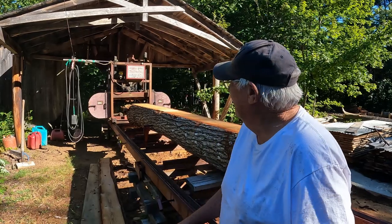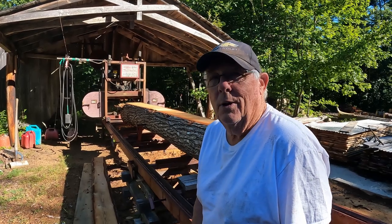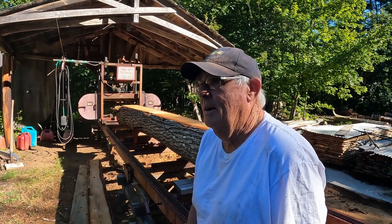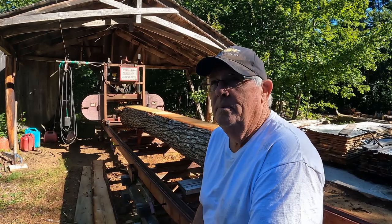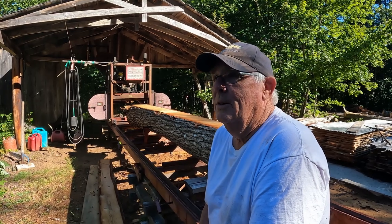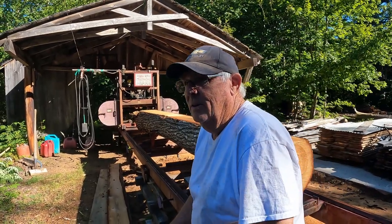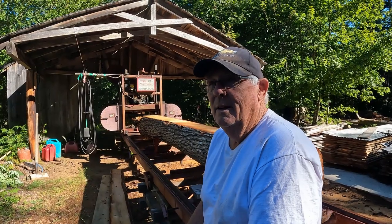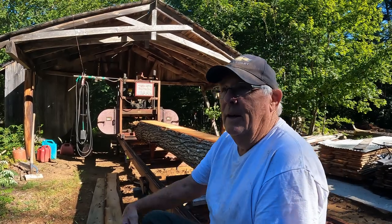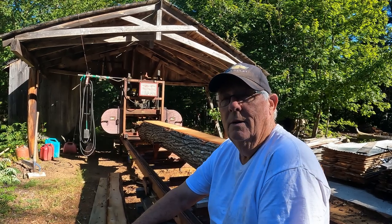But so we had a friend come, and he tested the cylinders to see how much compression there was in the cylinders. This is a two-cylinder air-cooled engine, and one of the cylinders had 100 pounds pressure, the other one had zero. Ooh. So we took the head off the side that was really bad and found that it had a blown head gasket. The head bolts in that side had kind of worked their way a little bit loose and caused this blow-by on the head gasket.